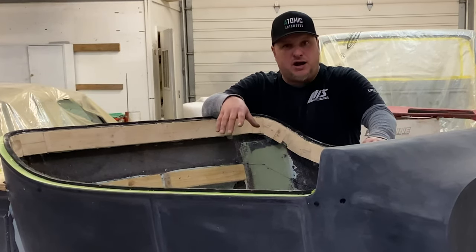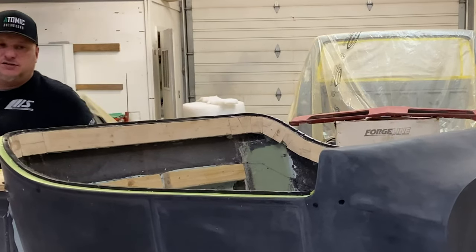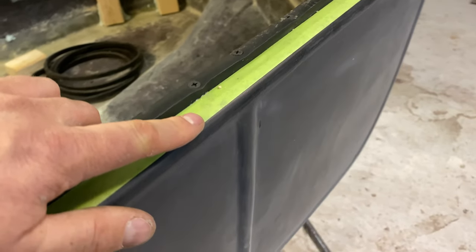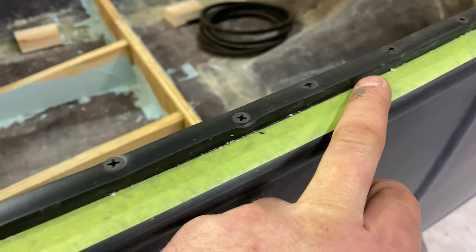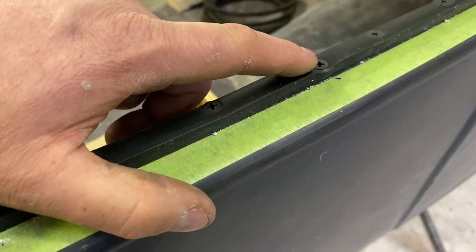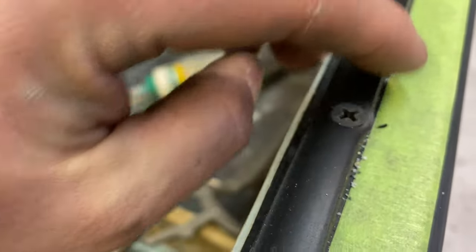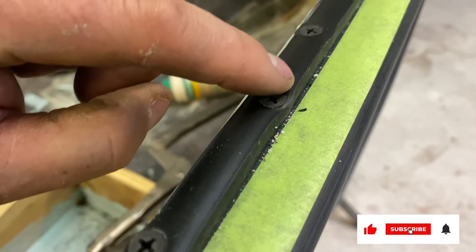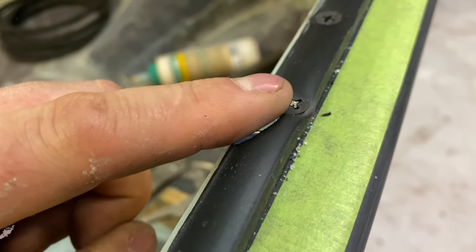As soon as I finish this off we're going to block sand it out and get it into primer. I do have to go through and fix a few chips and nicks. One trick I want to show you: I take regular three-quarter-inch tape, run it down the edge nice and tight and straight, then put the tack strip right up against it — that gives us a straight line. I also tried to drill on the inside and countersink the screws so there are no bumps on the outside. I deliberately put one screw on the outside so you can see what happens — you can see that little bump. The inside doesn't matter, but that outside edge is what matters when you go to put your outer upholstery in, so we're going to move that screw back.